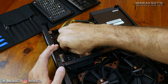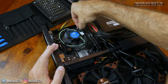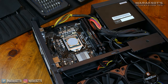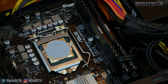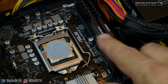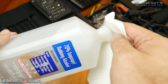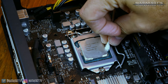To remove our current CPU, we first need to remove our CPU cooler. Depending on what cooler you have, this process may look very different for you than what I'm showing — which is an Intel stock cooler. Once you have removed your cooler, we need to clean the thermal paste from the integrated heat spreader on the CPU itself as well as the cooler. To do this, I typically use some isopropyl alcohol and a paper towel, and then some cotton swabs if needed.